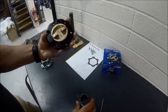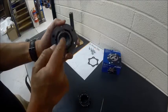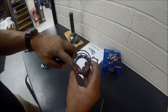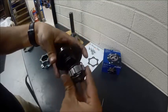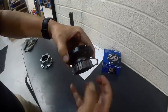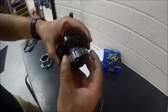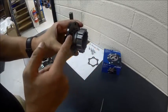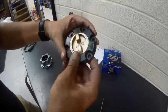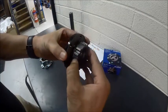Then grab the main end cap, always making sure we're in the free position. You'll notice we have two slots here and here, and two tabs here and here. Simply insert the spring, push in and around. You can see this ramp — this is what throws the gear in and out. That hub is now away from this end cap, so it's theoretically in a locked position, although we are in free on the end cap. Wind it back anti-clockwise, and there we are.